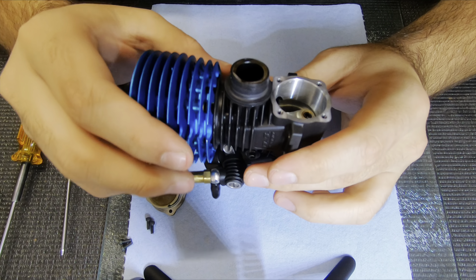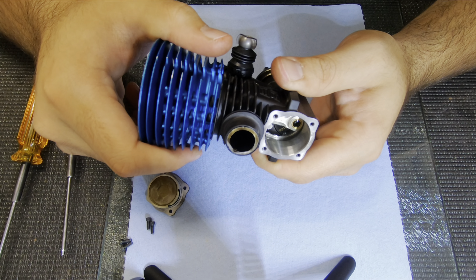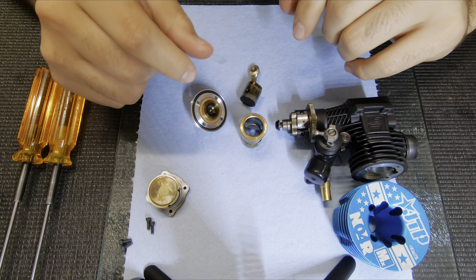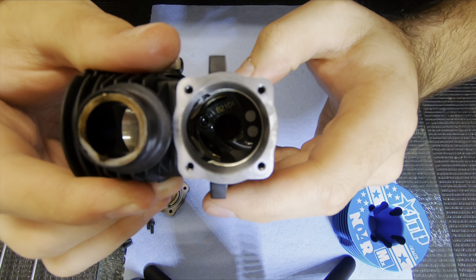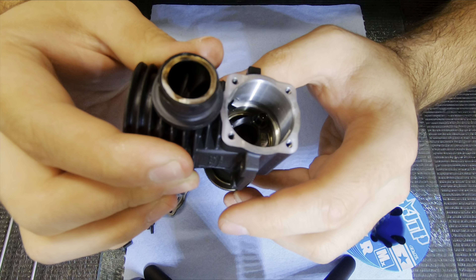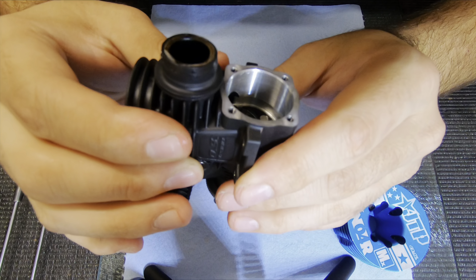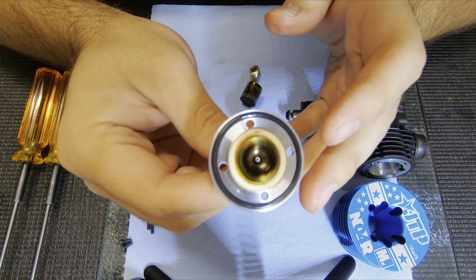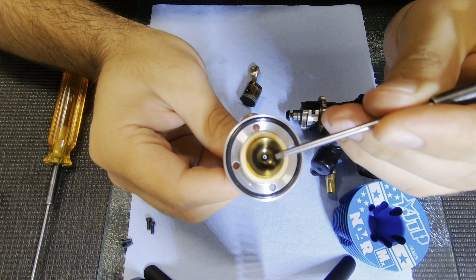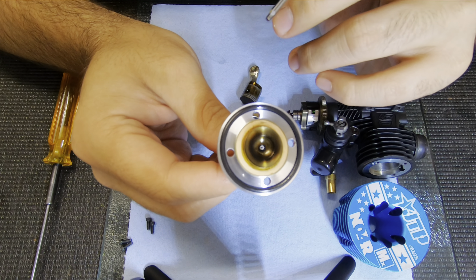So this is a good test to see what this fuel is all about. We'll go ahead and pull the cooling head off the engine, remove the piston and sleeve, and show you guys what the internal parts look like. We've removed the head button, the piston, and the sleeve. The block is nice and empty. Zero rust — there's a nice golden hue to most of the chrome parts on the aluminum block. The crankshaft doesn't have any rust, bearings are butter smooth, no notchiness. The head button has a really nice color pattern with that burn pattern, showing the caster-synthetic lubrication mix.